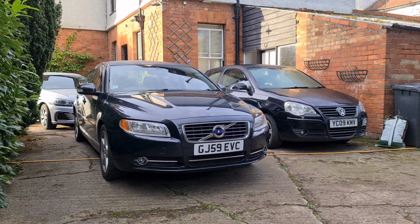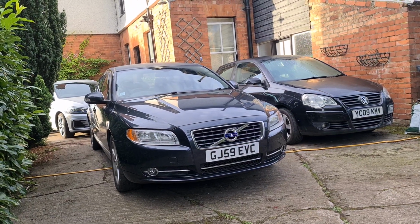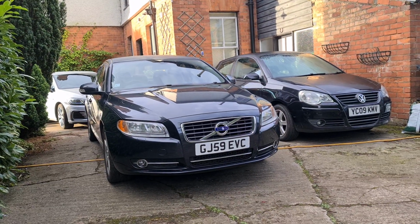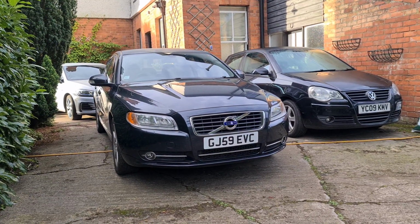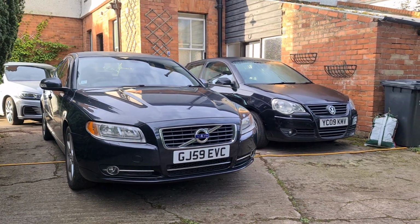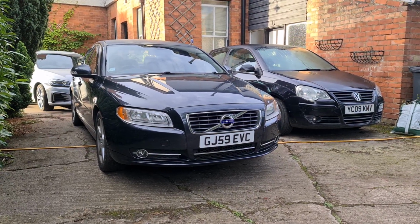Just a few things. When the regen is occurring, you can often get increased fuel consumption, because essentially the car is chucking more fuel into the mixture to make the exhaust temperatures hotter in order to burn off the soot. So don't be alarmed if your MPG drops, because it's just regenerating the DPF. Another thing that can happen is you can smell burning sometimes, and that's just the soot coming out of the exhaust or burning off the exhaust. You can also sometimes get some dark smoke. But these are all normal, so if that happens, then it's usually not a bad sign. If it's persistent and stays forever, then you probably want to get it checked out. But if you're intentionally doing a regen, or in circumstances where a regen can happen, then don't worry too much.